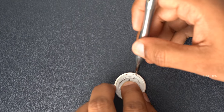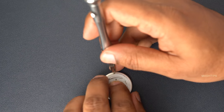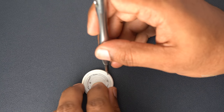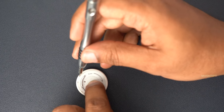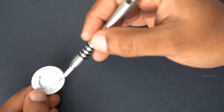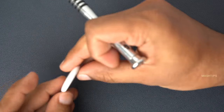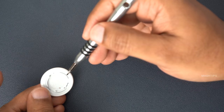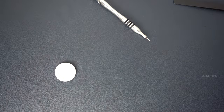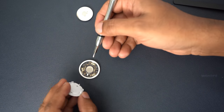This is the one we already tried — we basically poke a hole here with the screwdriver and gradually move it around the AirTag until it finally pops up. If you see any difficulty doing that, use a hairdryer and blow some hot air on this part, because this part is glued to the body. It's good to have some hot air to melt the glue — don't make it too hot; a mild heat will work.